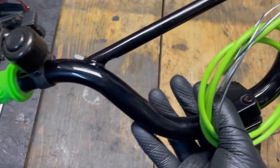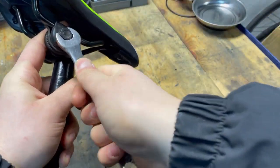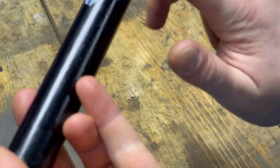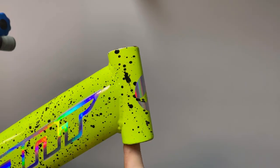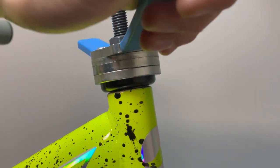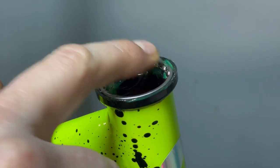You can see the saddle I restored, but there was a problem with the angle, so I decided to replace it with a new one — it looks much better. I use anti-seize on the seat post. Now I also replace the headset with a new one, because it's an important component and the cost is really low. I apply Shimano grease, new bearing balls, and tighten everything together.